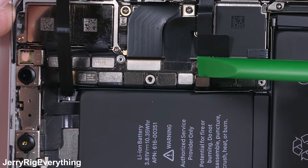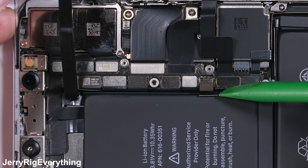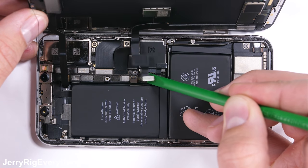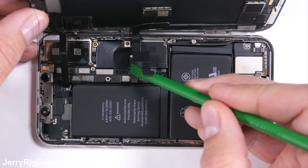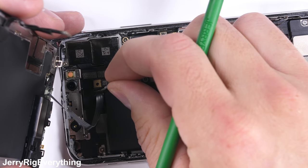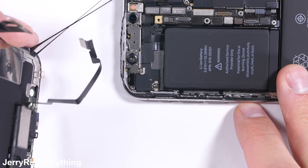The connectors we care about during this video are first the battery connector, making sure to use a plastic pry tool when lifting this off as to not short out the battery. Then we can detach the two screen ribbons, one at the bottom right and the other at the bottom left side of the connector row. The last one is for the earpiece and microphone, and it detaches like a little Lego from the motherboard. And here is the screen.